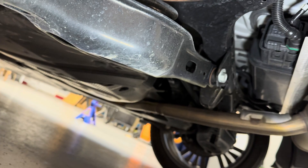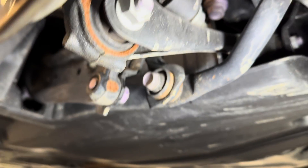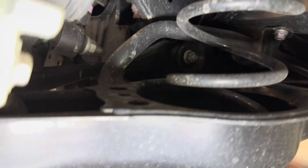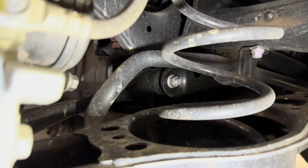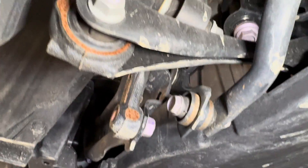Moving down below will show us the remaining two links. The one on the right contains a spring bucket and attaches to the rear subframe, and is going to handle your cornering loads. Moving forward we see the other link, which is much shorter, and that will help in stability when cornering because it will take a smaller arc.